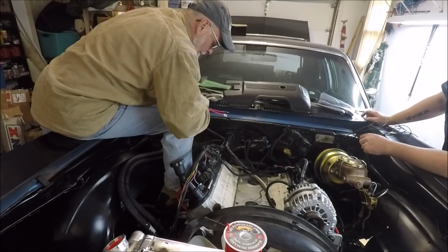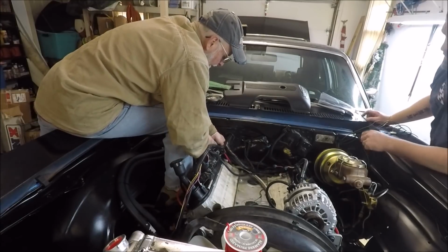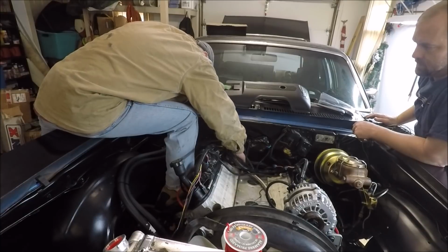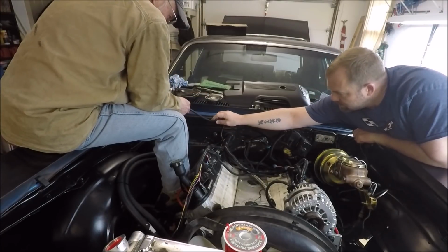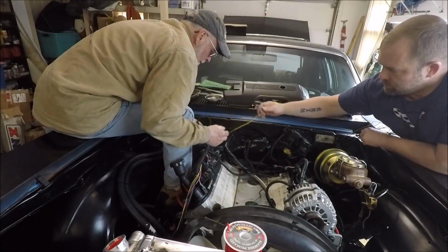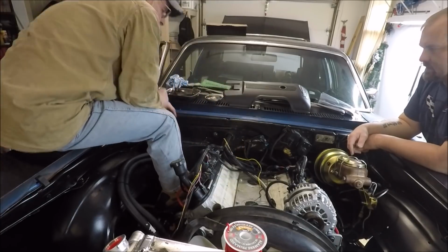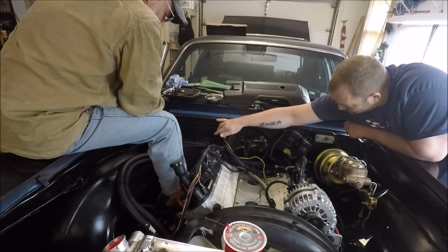That's the main power wires for the harness and the crank sensor. The crank sensor is right above the starter. Yeah, just if you can see where I ran those other wires down there. I'm right on the back side of the fuel line. Yeah, that's where it needs to be. So that's down there. Now what you got here should be an O2 wire. You want it down there too? Same way? Yeah, I would. What about these? Those I'm going to do something with. That's going to be your coolant temp sensor and your oil pressure, which is going to be right here. So you're already hooked up, brother. On the engine side, except for the stuff that's hooked to the intake components, everything's plugged in. You're golden. And then we're going to end up shoving this back to probably right there.